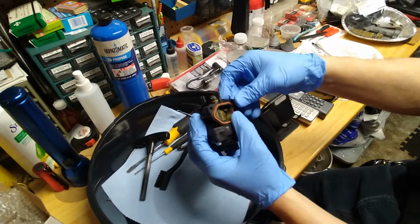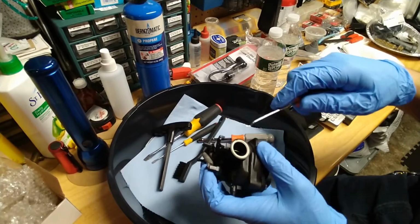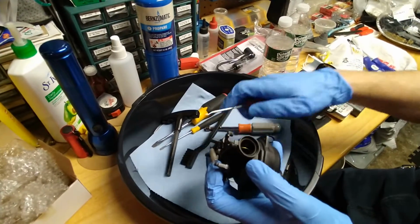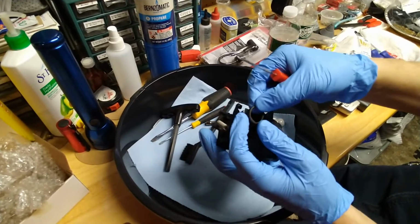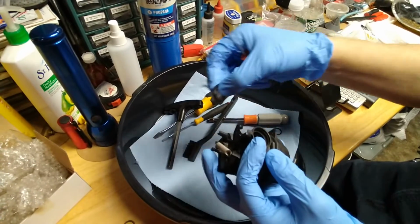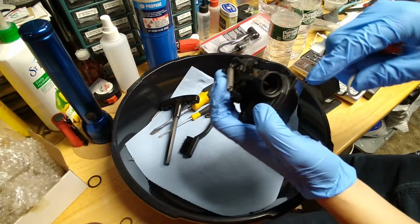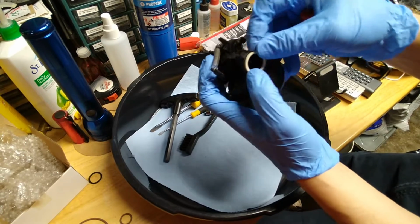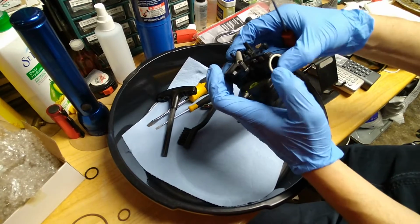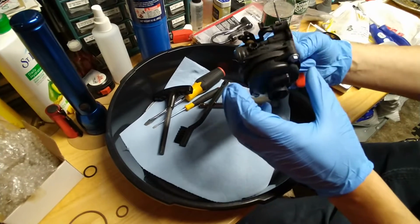Okay, that's in there. Now there's another O-ring under this snap. It's sort of like a snap ring that pops out. So take that out, and here's another O-ring that we replace. Let me pick the right one here. I think that's it. I'll put this in. This is important: before you put the carburetor on, this goes in and this snap ring goes over. Oops. There we go. You'll hear it snap in. It's snapped right in. And now we're all done rebuilding the Briggs plastic carb.